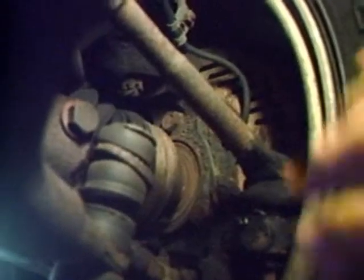But what you can do also is grab a hold of the bar. The tie rod end's out there. And you can shove up and down on the bar. And if you feel it move, like jump, then you know your tie rod end's bad, which would cause your slop in your steering wheel. Now, like I said, this is looking on the inside of the wheel. Your tie rod end is right here.